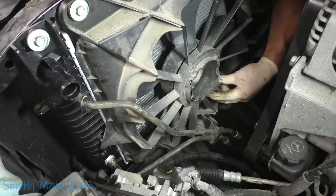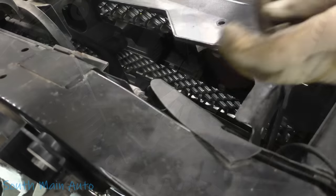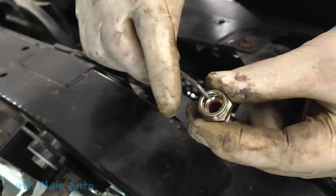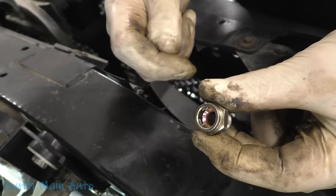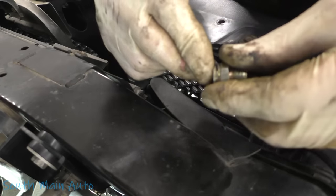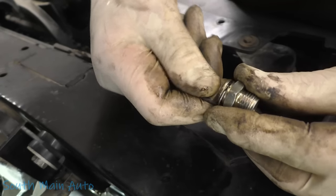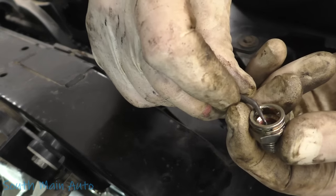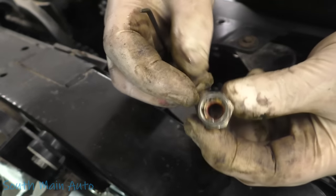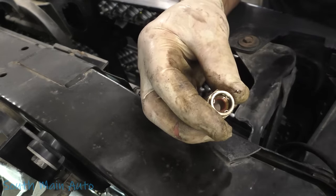There's one plug — both your fans back in. Trying to put the lower transmission line in but it won't go in. You can see when the little guy over in China put this thing together, he stuck the e-clip on the inside of this sucker. So what we need to do is pull this e-clip up and out of that groove. There we go — we just had to stick it past so the three little ears aren't sticking in so far. And just for the record, these are super loose too. So let me screw this back in the bottom of the rad and hook that lower transmission line back up. The upper one I've already tightened.